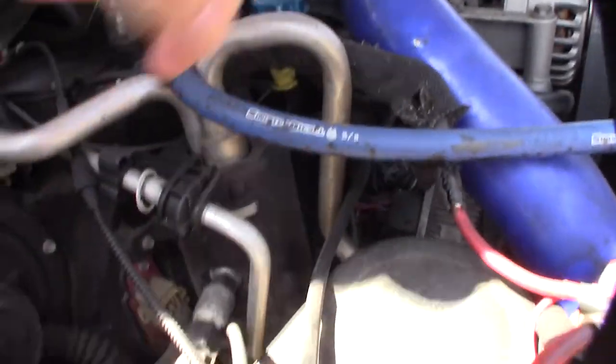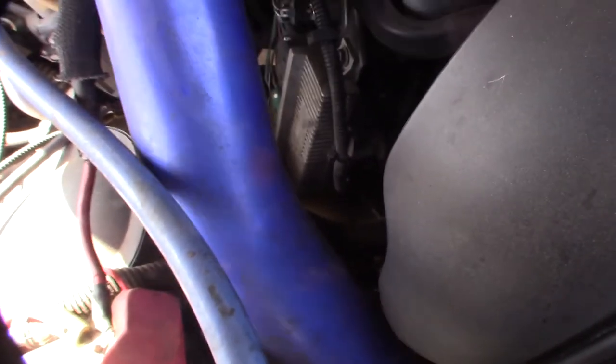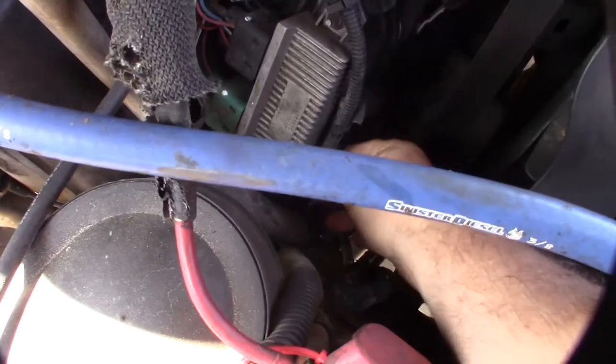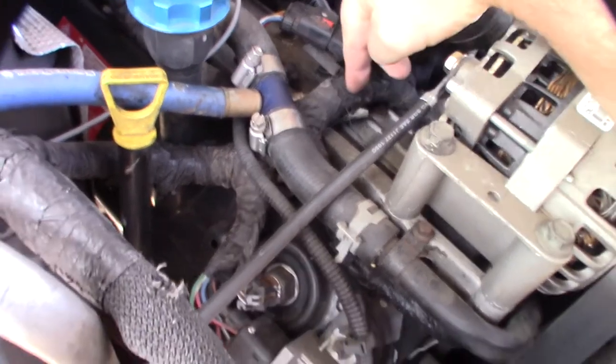That's down there. Alright, so I'm going to take the tube off, at least it makes it easier to get to this connector down there, the glow plug module right there. So this is the first harness right here. It comes up around, and this is the first place where I'm actually going to test resistance. And this actually then feeds back into this harness back in here.